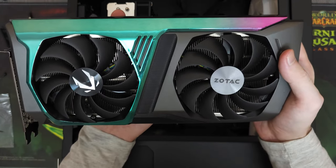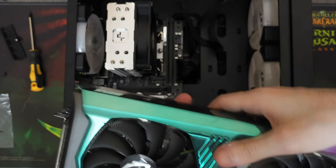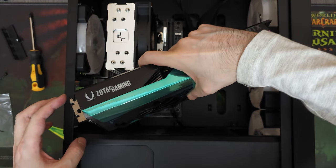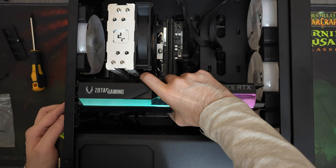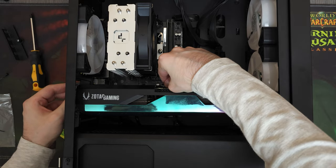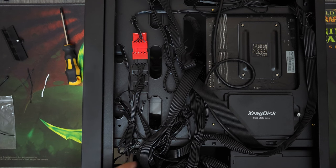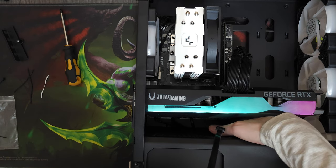And of course, the GPU — RTX 3070. The GPU prices here are quite high at the moment. RTX 3070s go for around 350 US dollars, if not more. And when I saw a listing of this GPU for 280 dollars, I grabbed my phone, gave the seller a call, and told him that I wanted it right away. He let me test it at his spot, and after a few minutes of 3DMark stress test, the GPU showed around 75 degrees, which is kinda high for this model. So I took it home, opened it, cleaned it, even though it was pretty clean already, and changed the thermal paste on it, which dropped the temps by 7 degrees. But because of how cramped everything is here, you might see the temps go as high as 74 degrees on the GPU.